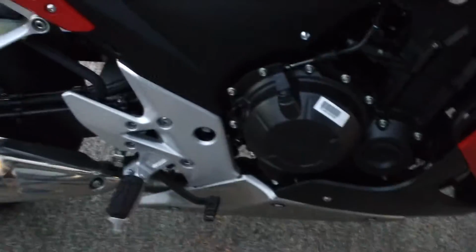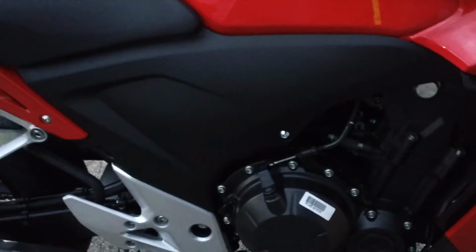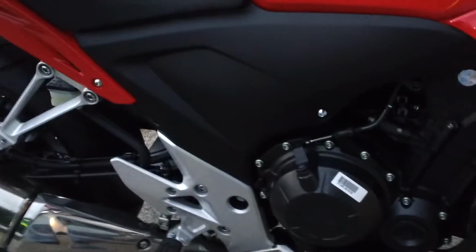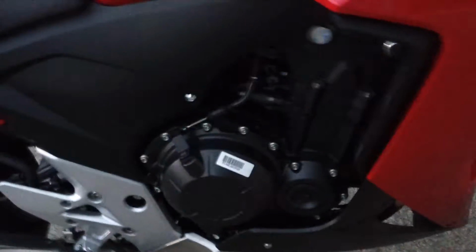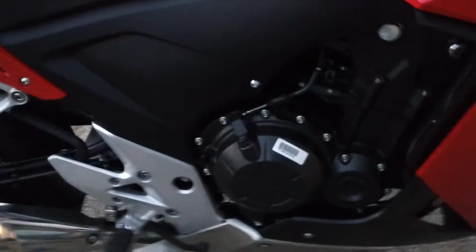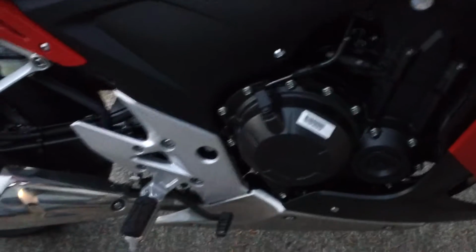correctly. Whereas if you use the baby method or the manual way of breaking in your bike, then it's not going to have as much performance, and it's not going to have as much fuel efficiency, and is honestly not even going to sound any meaner because obviously you're not getting that added performance, and you might not get the piston rings set in correctly. So when it comes out the exhaust, you might get some blowback from the engine in the exhaust. So it's just not healthy for the bike. So I always recommend a hard break-in method, but not an insane break-in method.